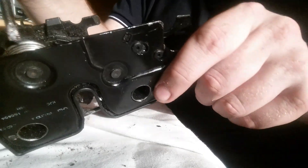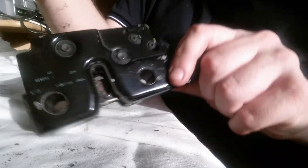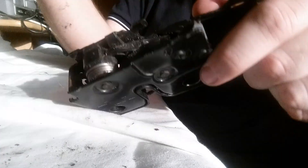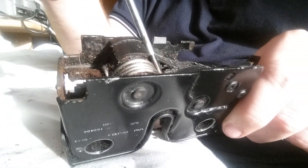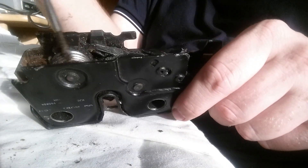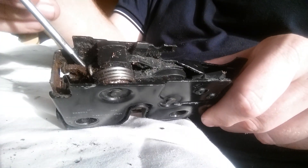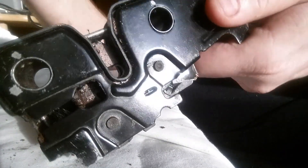What I did is I sprayed it inside here and made sure I got a screwdriver into every nook and cranny. I separated these springs, and there's also a spring at the bottom end of the lock — they've actually changed the design of this lock on the new one. What I did is I literally lifted the spring and then sprayed it under there, cleaning all the compartments and spring connectors. Then I primarily applied grease down this joint here and on this joint here, and put some inside the connector housing and inside where the bonnet lock re-greases and goes down.